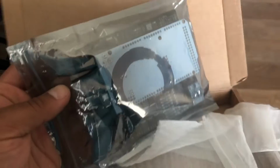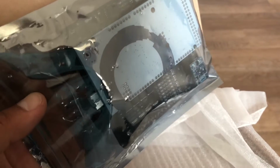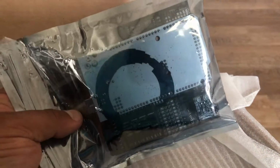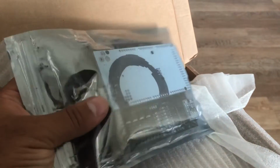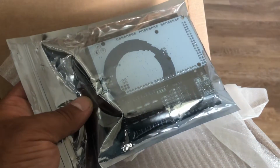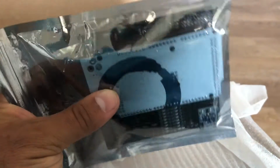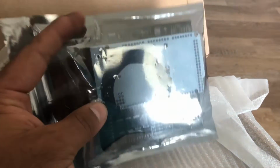So effectively, this is a Speeduino UA4C. For those that don't know what it is, it was an ECU developed probably about 3-4 years ago by a guy in Australia called Josh Stewart. It's open source, very similar to what Megasquirt was. It uses Tuner Studio. It's effectively run by a Mega 2560, which is this board here, which is kind of like a Raspberry Pi.